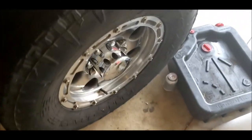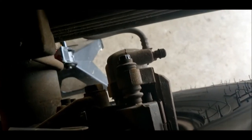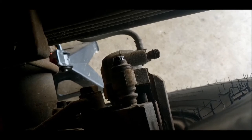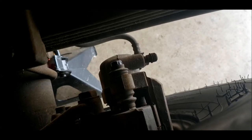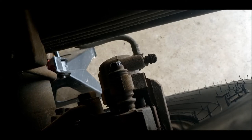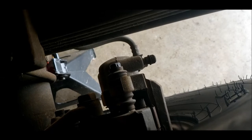On the back side, I just took out those 22 foot-pound screws, took those out and just put grease on them. I did not unmount the calipers at all, because the rear brakes don't get near as much work and they looked in pretty good shape. So it was just a front brake job. But while you're at it, you might as well pull just those two bolts out on each side in the rear and put grease on them, then put them back in.